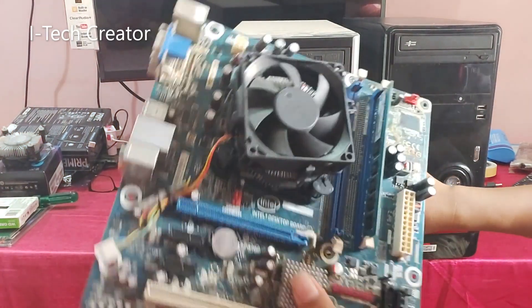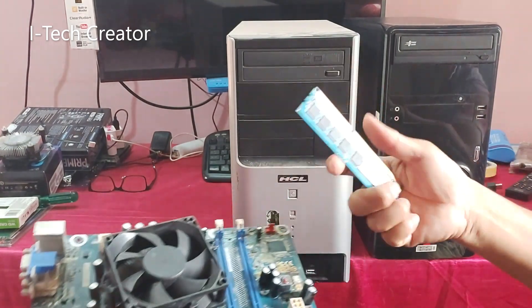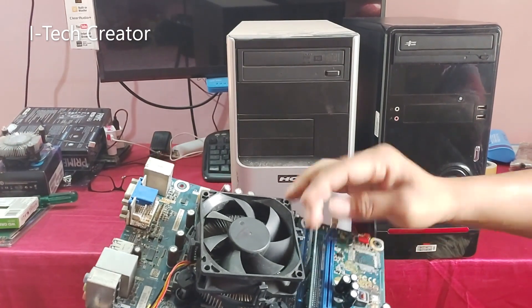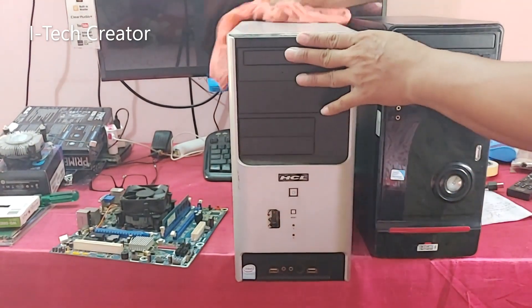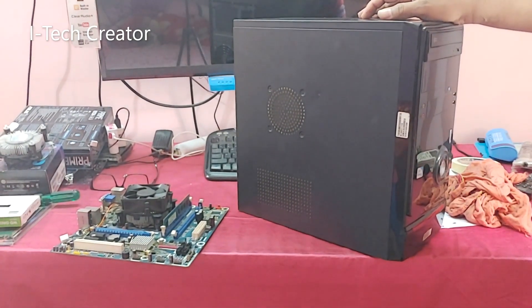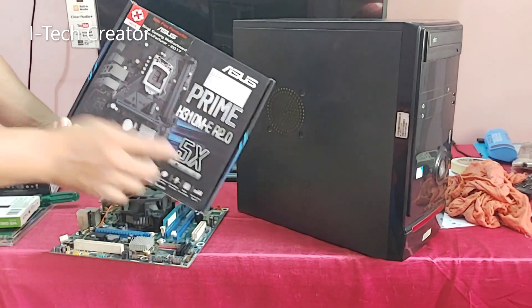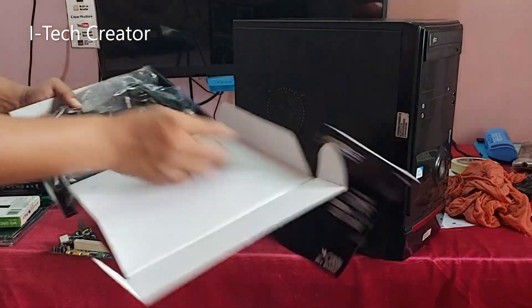This is an ACL brand old PC. It originally came with DDR2 RAM and an LGA 775 G31 motherboard. The owner then upgraded to a DDR3L H55 motherboard with a first generation processor. Now the owner is upgrading again to an 8th generation processor. I am suggesting buying an 8th gen processor, DDR4 RAM, and a matching motherboard.